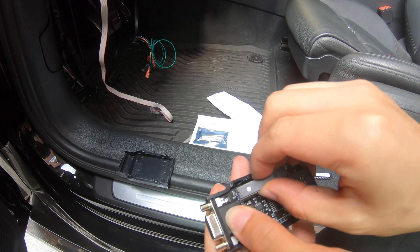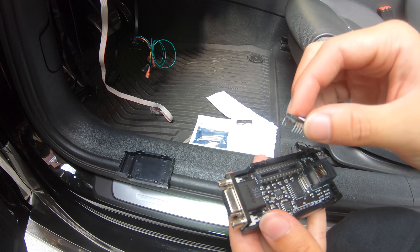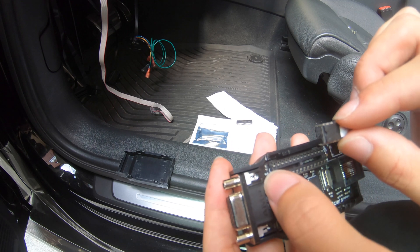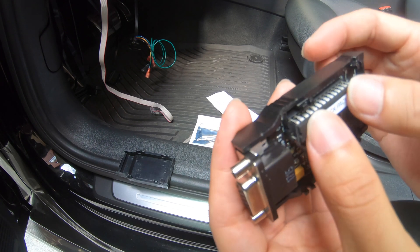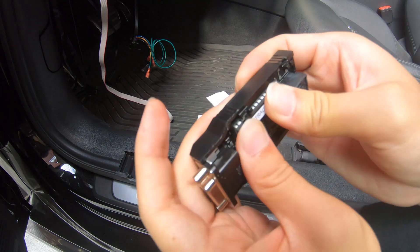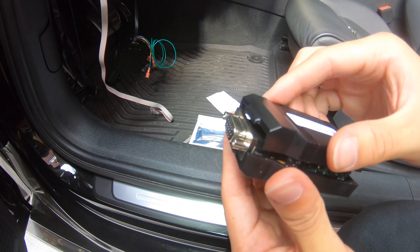Finally it's off. Pull it out gently — you don't want to damage all of these small pins. As you can see, there's a dot here, and right now this dot is facing this side. Be sure you have the right position and push it in. Make it tight, and now we can put this cover back.